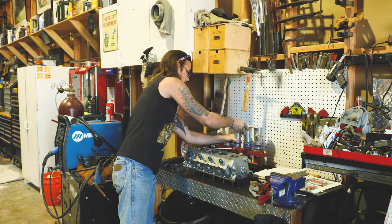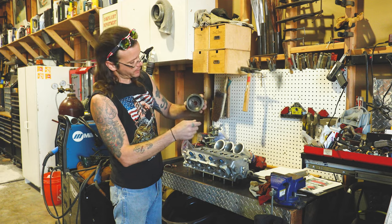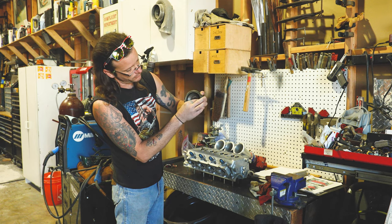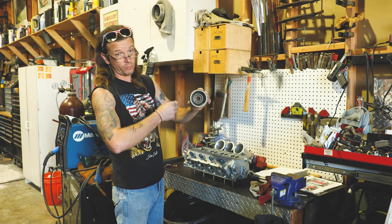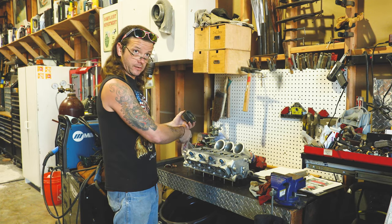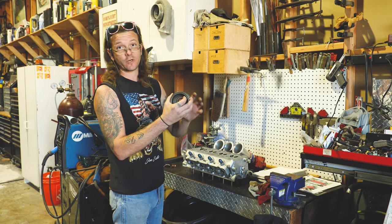Another trick thing that Ferrari did on almost every engine they ever made: the cam gears have a kind of circular vernier gauge. The circle that this sits on is slightly smaller, and when you take the pin out you can move it a minute amount — it gives you an almost infinitely variable cam timing relative to each other and to the crankshaft. You can make this engine idle at 800 RPM, pull all the way to 15,000, or even have vacuum for power brakes. You can do almost anything with the timing, but you can also tune yourself into destruction.